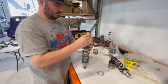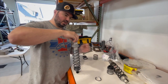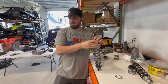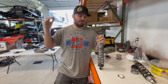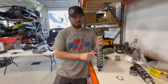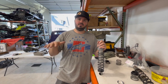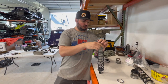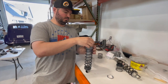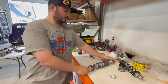What's the main purpose for us doing this? We're trying to make it stiffer. We want a stiff front shock and soft rear, because we want the sled to basically wheelie over backwards. And to do that, we're gonna make the limiter strap as long as possible, stiffen and put an extra preload in that front shock, because that'll make it bite. And then with the soft rear, it's just gonna want to wheelie on you. Awesome. Cool. You have pretty much infinite preload options with a setup like that. Nice. So there you have it.